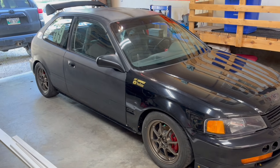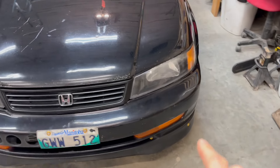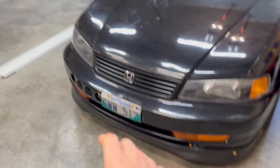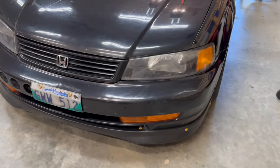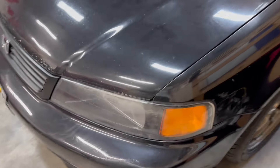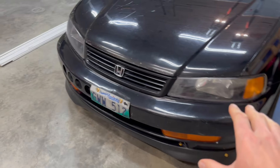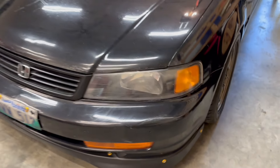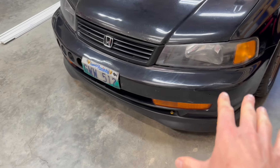This is how it is currently sitting. I have it mostly put back together. The bumper I had to do a bit of modifying to make it fit because I have a battery relocation behind the bumper here, and it's actually not meant to be on the driver's side — it's supposed to be on the passenger side. But because of how my intercooler piping is routed I could not mount it there, so I had to do some custom work on this side. Right there is the battery, and I had to do some custom work to get it mounted on this side, which actually pushed it quite a bit farther forward than it's supposed to be. So then I had to customize that bracket a bit more and do some clearancing. It is actually pretty tight — right up solid against that bracket — but at least I know that bumper is not going anywhere.